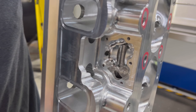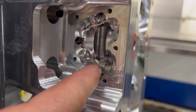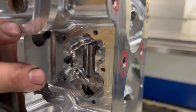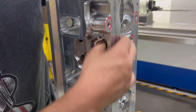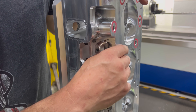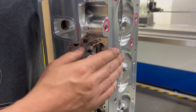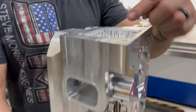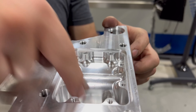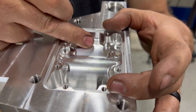That water then goes up and over, down to all the inside passages. It comes on the other side of the combustion chamber — not under the intake port, but in between the intake ports and up against the chamber and deck surface to cool that portion.